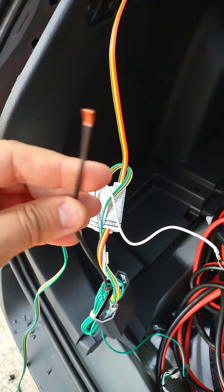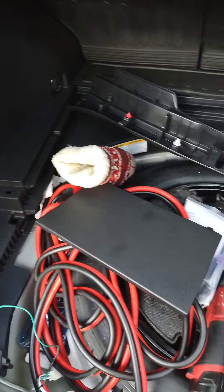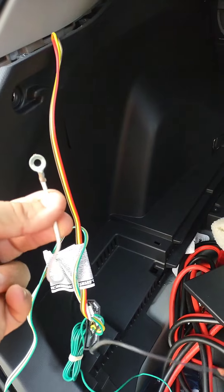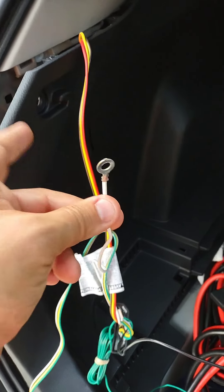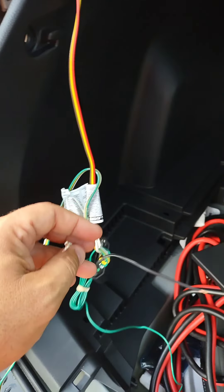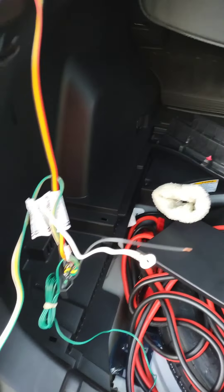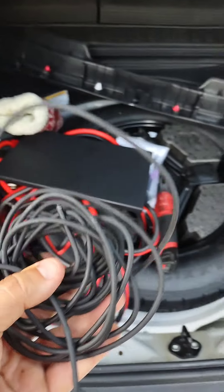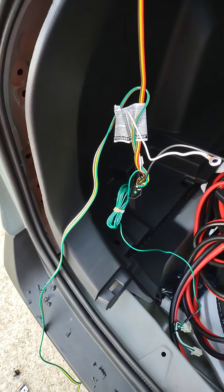The black wire is going to be a power wire that needs to be powered by the actual battery — so there'll be a power wire ran from the positive side through here. The other connector, which is a white wire, is going to be the ground wire. Those are the two things that need to be connected — the ground somewhere in the chassis, and the power connected to a power wire. They gave you a long one because normally you have to run from the front of the car, but this one is going to be a lot shorter — about four feet.